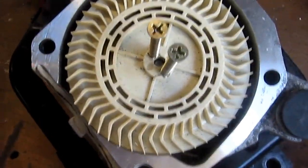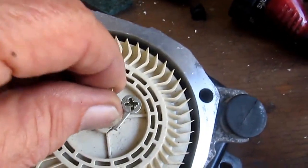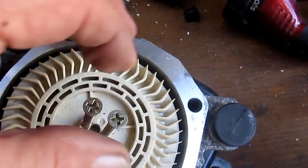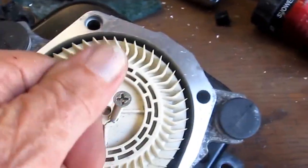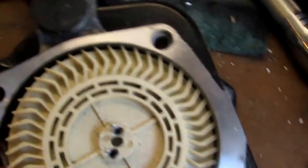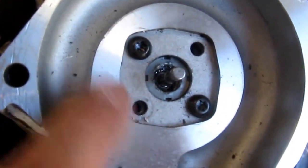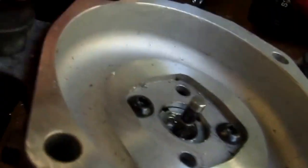This is just another way. Once you start to bottom out, it's quarter turn, quarter turn — just keep doing that and watch it. You may also have to kind of tap on it a little bit to bump it off, but it does come off. I put these in temporarily so you can see it. When we pull up, we've got four bolts — one, two, three, four — it's pressed on that little spindle.